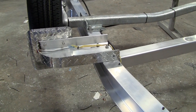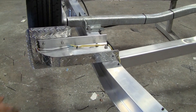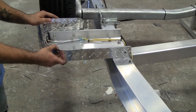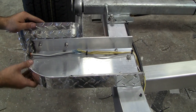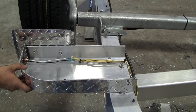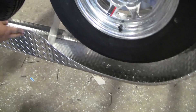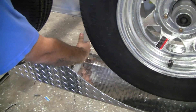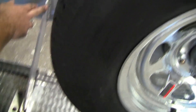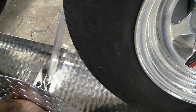The how-to video earlier was done on a trailer that we don't manufacture. This is our standard trailer and we offer a lot of different things. Starting with the steps, we offer a quarter inch by eight inch channel, which is a full piece with custom welded trim work and all stainless steel hardware. For standard, we offer teardrop fenders and our mounting hardware for the fender bracket is much stronger as well. We offer two-by-two angle on the fender side and on the frame side, as well as three-inch flat bar mounted vertically, which makes it a lot more sturdy.